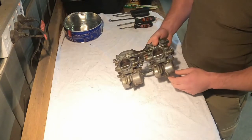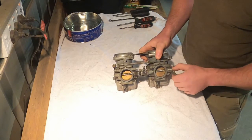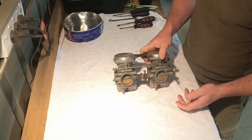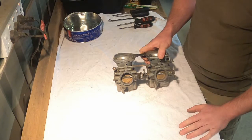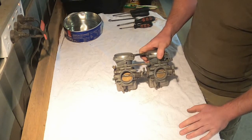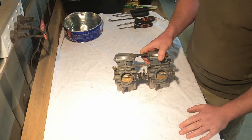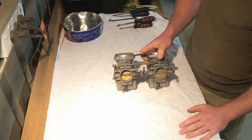I'm really curious to know what he did with these carbs, and as you can see they're pretty dirty, so I'm just going to pull them apart and clean them up to see what jets he's got in there. It was actually running pretty well — it did smell a bit rich on idle, but other than that it pulled pretty evenly through the rev range with no flat spots. Because it was running a bit rich at idle, I'm hoping that when I put these pod filters on it'll still go alright and I won't have to mess around with it too much.